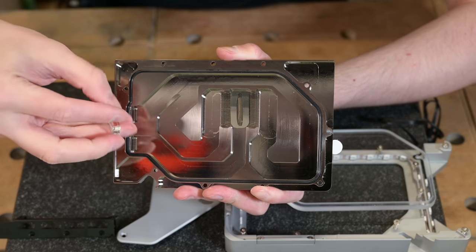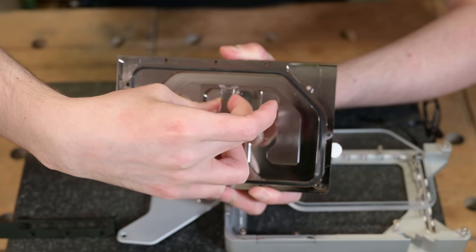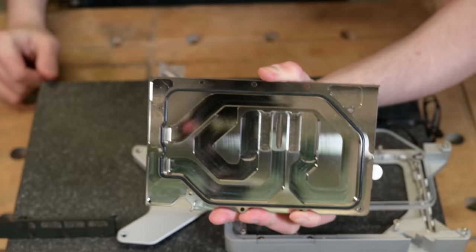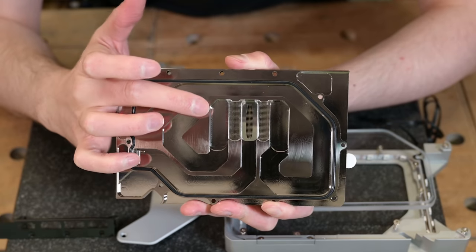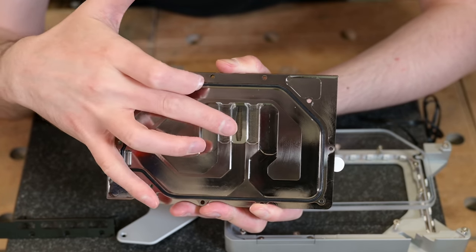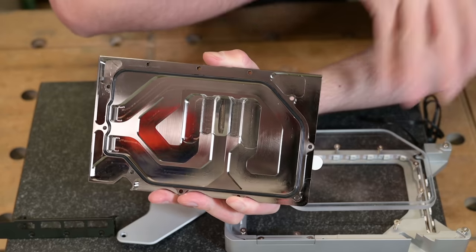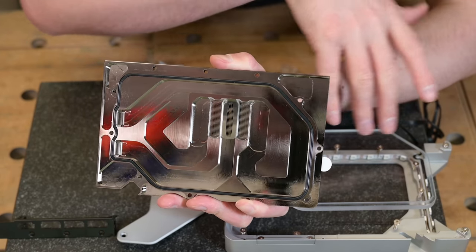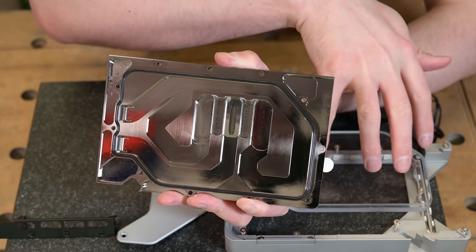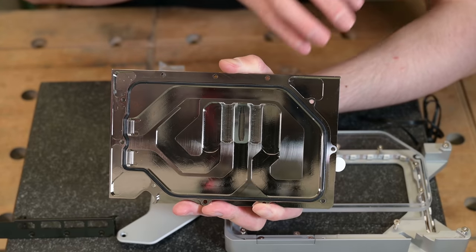And then you have these little inserts. So these are made out of acrylic as well, and they look as if they've been laser cut. And these slot like so. Now the clever thing about doing it like this is that this basically keeps this whole assembly separate. You don't need to have it all machined, which means you're not gonna have any machining marks, tool wear problems or anything on this side of acrylic. It means you can use thinner acrylic. It's not gonna be as expensive. So from a production value, that's quite an interesting thing. And actually it's a better solution.